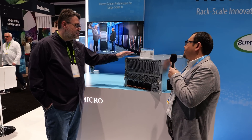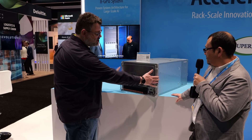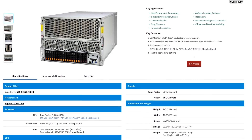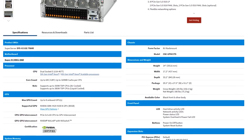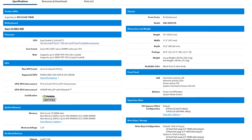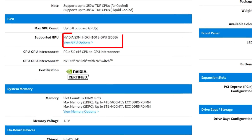Standard rack systems for HGX are not just limited to PCIe. If you want a full eight-way NVLink setup, you're going to need something a little different — Supermicro's got you covered. In a similar 5U chassis but with completely different GPU interconnects, you can get modular H100s and soon B100. This version of Blackwell is coming a lot sooner than the PCIe version. It's hard to do eight-way NVLink with bridges on PCIe cards, but Supermicro's got you covered in a similar 5U chassis.